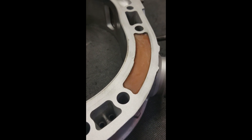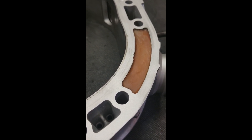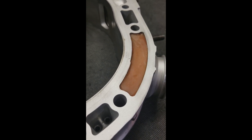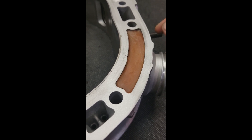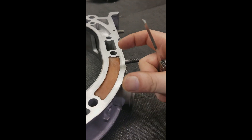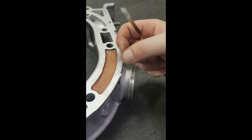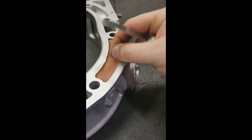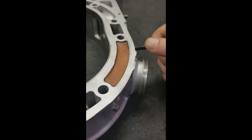This happens to a lot of two-part fillers — a hardener and a base. Once it cures, it shrinks based on the manufacturer's specification. With heat cycles, it slowly just shrinks and shrinks as the aluminum heats up, expands and separates. So the filler always moves away from it, shrinking inward rather than expanding with the aluminum.